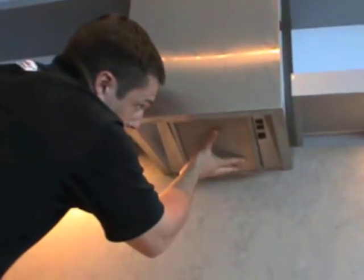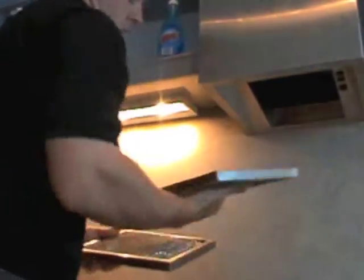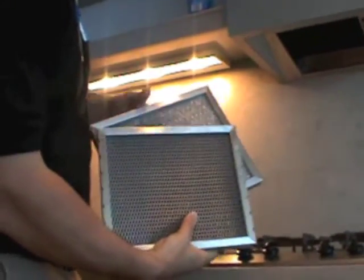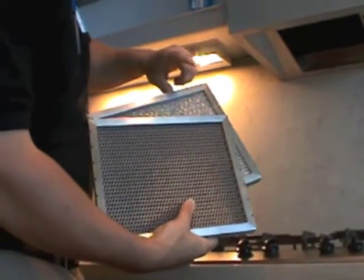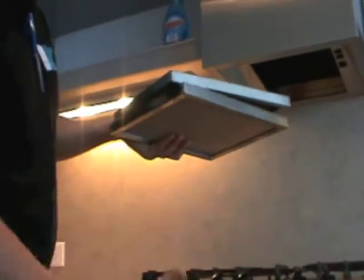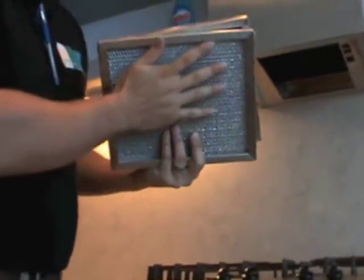The two filters it has — I'll show you here. You'll see the two filters: one is black in color and one is silver in color. The silver one is your grease filter. This is the one located on the bottom, and it's going to capture all the grease that gets sucked up into your fan. It'll get caked with yellow grease, and you can actually clean the grease filter by sticking it in the dishwasher.